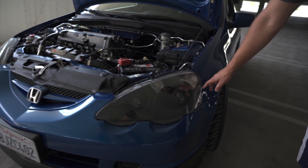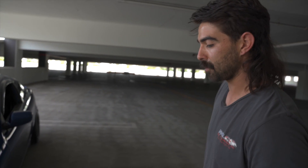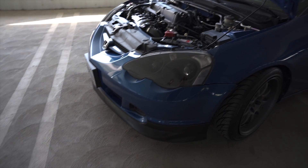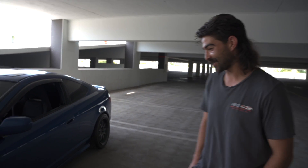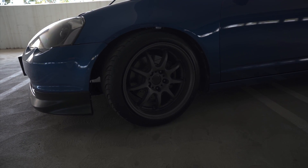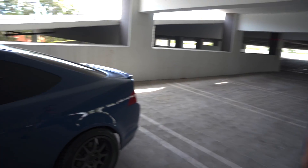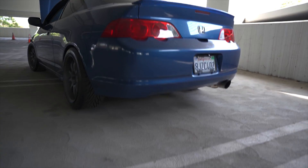There's a little cosmetic stuff — K-Tune power steering line, flush mount, Skunk2 covers, some hybrid stuff. The headlights are dual retrofits from Morimoto — HID projectors on the low beams and LEDs on the high beams. It's got a replica A-Spec lip that I just put on because the Type R one flew off on the freeway. It's on Work Emotion D9Rs — 17x9.5 +38 — with a 15mm spacer all around.